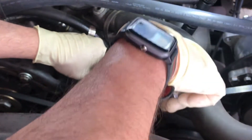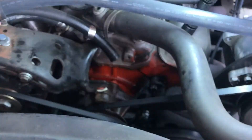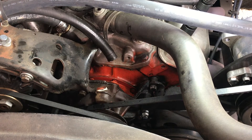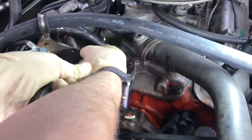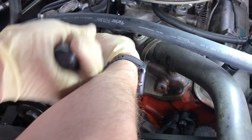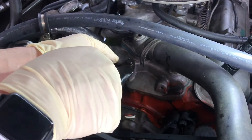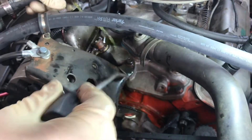Alright, that looks good — that's going to be fine. If it leaks, we can do it again. Let's jump up to the other one. Take that clamp — we're going to move this up here. 5/8" is going to go up there. This one's probably going to make a mess on my intake. I'm going to have coolant everywhere. I freaking hate coolant — everyone hates coolant. Such a pain to clean up. It just gets all over everything and it's sticky to walk in.